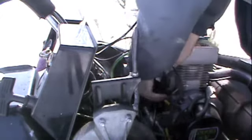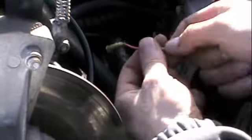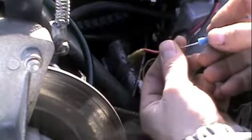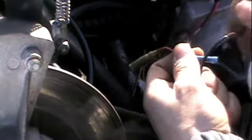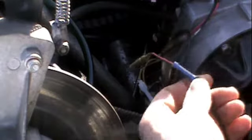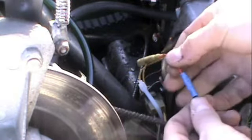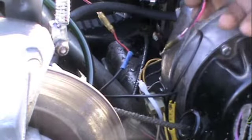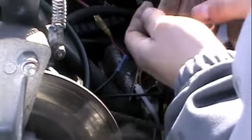This goes to the red wire. Twisting them together. There's one there — jam that in there. Make sure they're all touching and really close together. Take your dykes, squeeze them together carefully — not to break, just want to squish it for a firm connection. Nice and strong, and plug her in. We're going to go for the long one. Short one's on there. Now we got this last connect — this guy to that guy — and we'll twist it together.